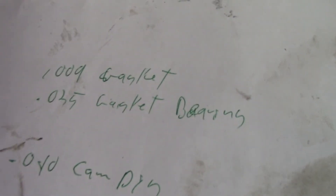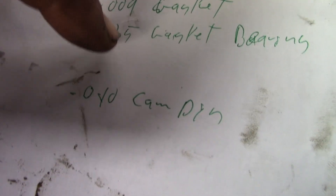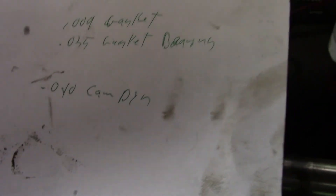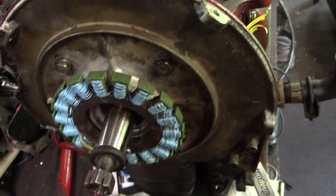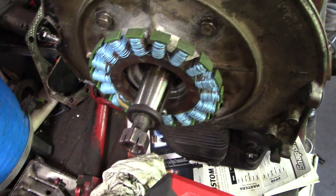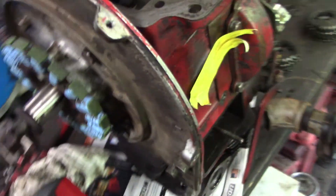I wrote down some of the gasket depths — if you can read that. The one gasket was nine thousandths, the white one, and when I tore it apart it was about thirty-five. It's a good idea to do that. Experiment with it. When you tighten this, put the plate on here, just snug it a little — not torque it down — just snug it a little bit and try it. The crankshaft goes clink, clink — too much play. You're going to take gaskets off until you get the desired end play.